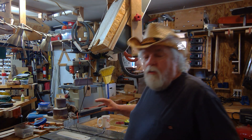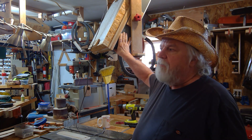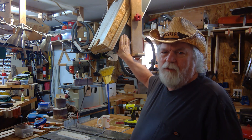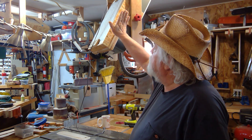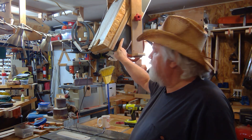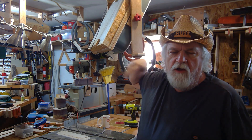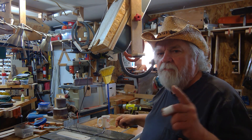Let's take it apart here real quick. There are three major components: the box fan itself, which is just a 20 by 20 box fan — you could use any fan you wanted, but the box fan works well for this particular style. Then there's the filter box, which houses the two filters and attaches to the back of the box fan with screws. And then there's the pedestal, which holds the unit up and also mounts it to the ceiling.